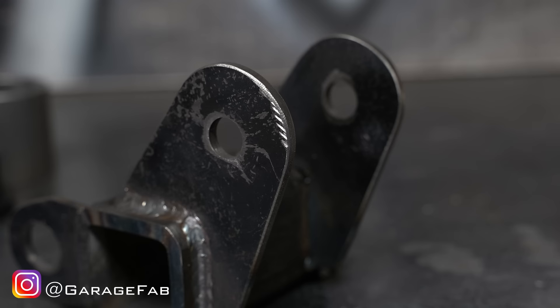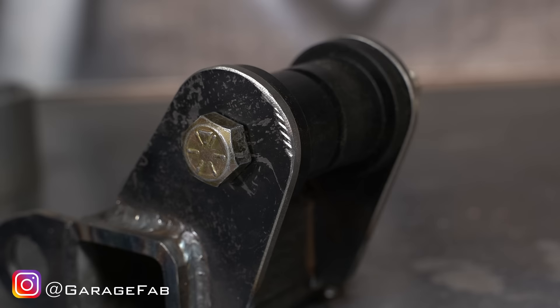There are five main components to a bushing: the bushing tabs, the through bolt, the inner sleeve, the bushing material — in this case polyurethane — and the outer sleeve, which will usually be welded to the end of a link bar or a control arm.